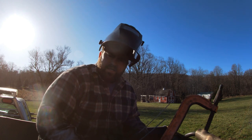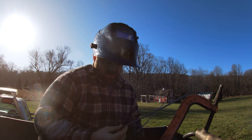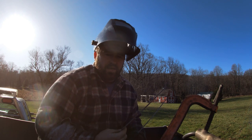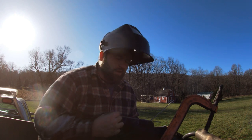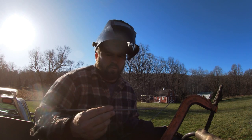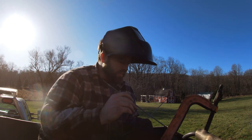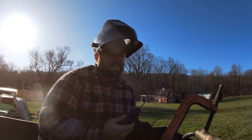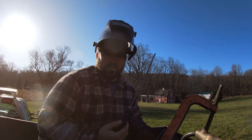That looks kind of cool — doesn't look too bad. Sorry about my voice, it's a little hoarse, I got a little cold. Anyway, I want to talk about welding rods for this case. For about 90% of the jobs I do, I like to use 6010 welding rod and also 7018. 6010 is a great rod for welding metal that's imperfect, or if it's got some rust or you gotta plow through some crap in the metal — 6010 is great and it makes a great root pass. For this application, doing some heavy plate, I'm gonna do a root pass of 6010 and then a cap of 7018. 7018 bonds great with 6010 and provides a beautiful, good finished look.